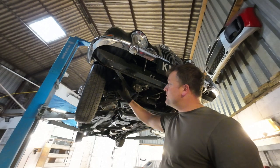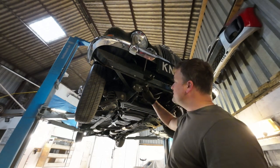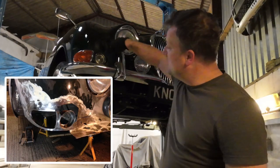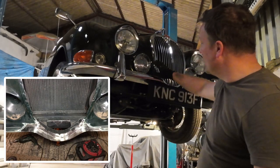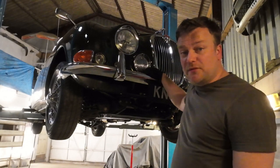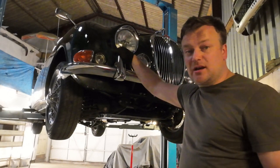On this car, this reinforcement is new and the cross member is new. There's also a shield that goes in front of the front cross member — a very simple part that protects it from debris. I've replaced the brackets the radiator sits on, rebuilt the longitudinal, and there's more cosmetic work above the front bumper line too. There are rust traps behind the indicator, behind the side light, and in and around the headlamp. The saddle underneath the grille that joins the two front wings together had rusted out, so I made a replacement for it. Once all the new metal was in place, I very carefully rust proofed back inside the inner wing — taking away anything left, cleaning it up, and rust treating.